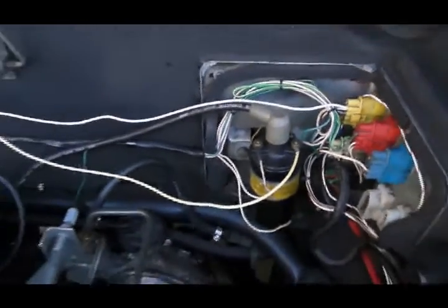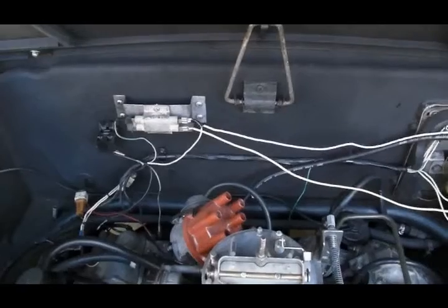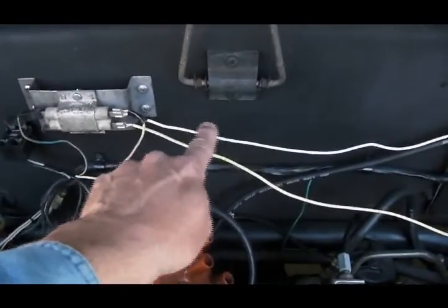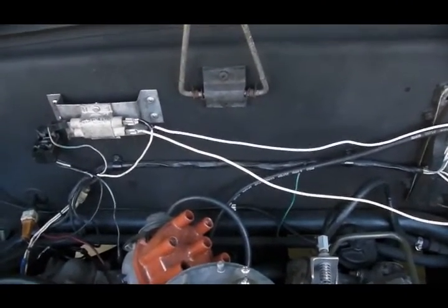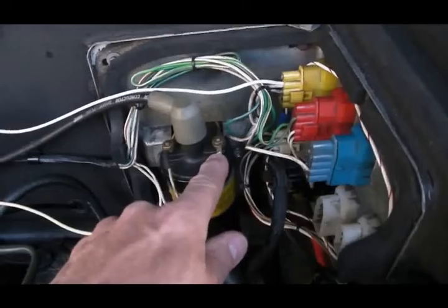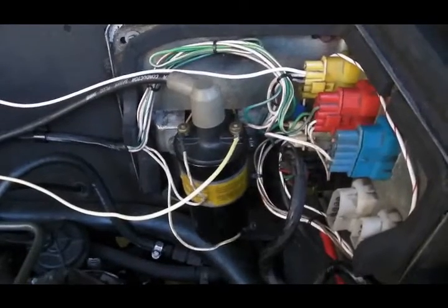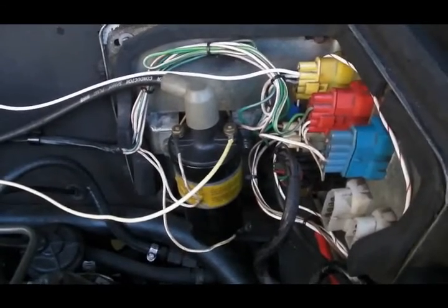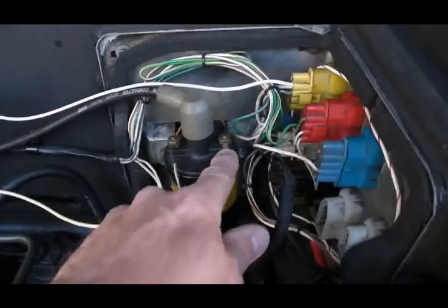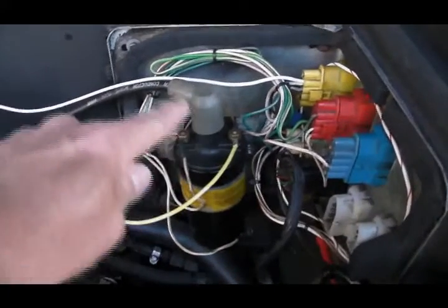So that is how the original circuit is wired. The purpose of the resistor grid is that the white wire is going to be anywhere from battery voltage all the way up to full system charging voltage. But after running through the resistor grid, when it gets to the ignition coil, the white with yellow wire is only going to have somewhere between 6 and 8 volts on it. So that is what the stock ignition coil is working with - it steps up those 6 to 8 volts and steps it up to probably somewhere in the 10,000 to 12,000 volt range and then feeds it out to the spark plugs.